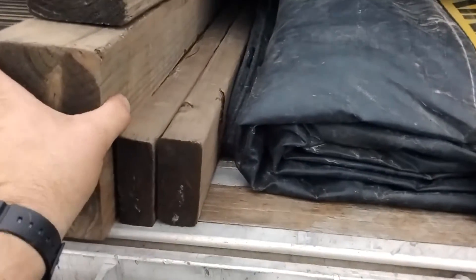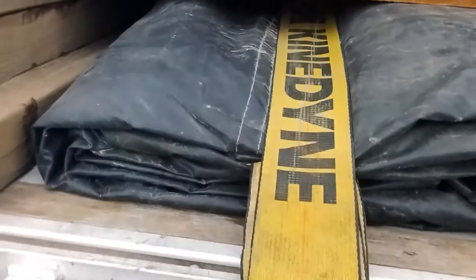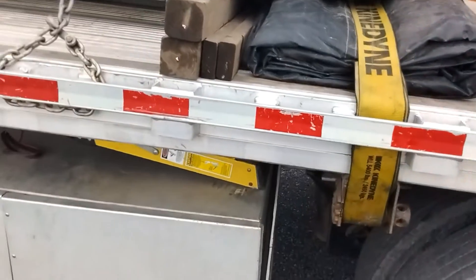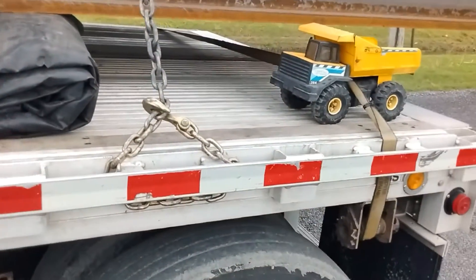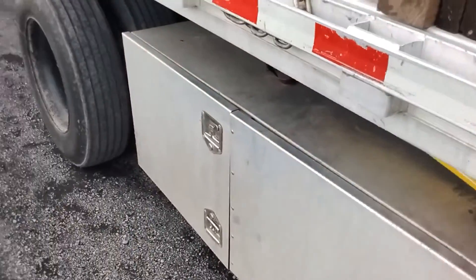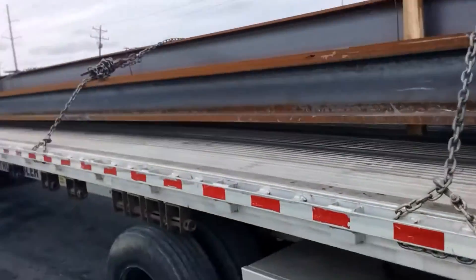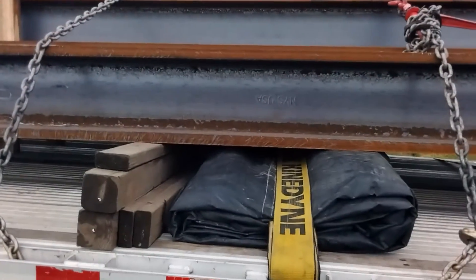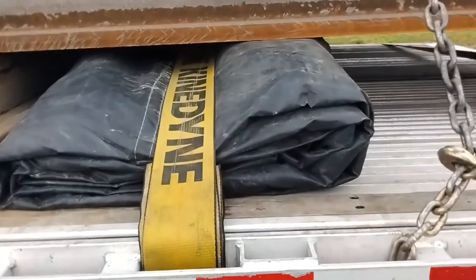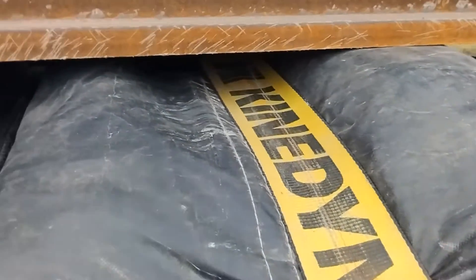These aren't gonna go nowhere, trust me. For you guys that gotta have your tarps on your deck — little trick, use the back of this trailer to your advantage. It's honky strapped down and ready for the trip to Ohio. Ratchet binders in the back and the front, suck them beams together, and I got my four snap binders. Back up and look at this — I think it's actually sitting about level. This worked out pretty good.